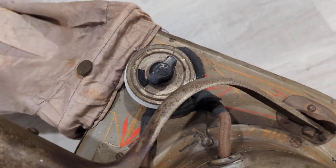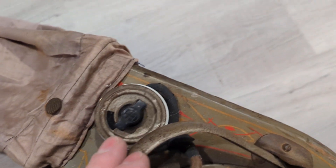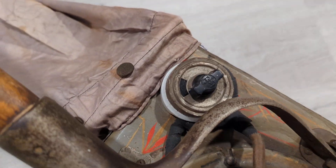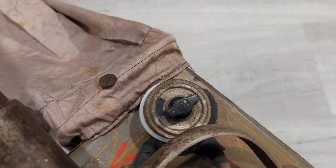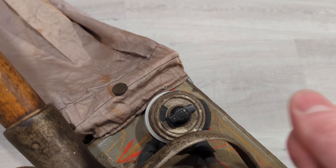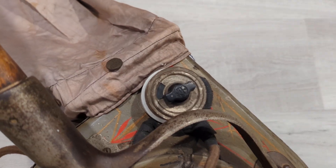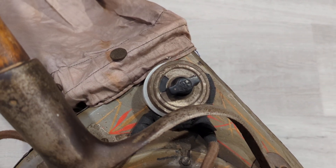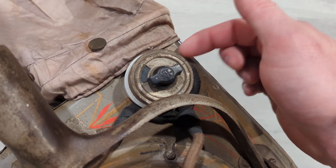This power switch — Perkins made a lot of these switches, no relation, but this one has an E on it, possibly from Emerson. There is a little window where it's black when the thing is off and white when the circuit is completed. This switch was also temperamental. I found that in reassembling it, it has to have a preload on the spring before you put it together and insert the clip. I fixed it, used it a few times, and it came apart on me. That clip popped off, so I had to re-fix it.